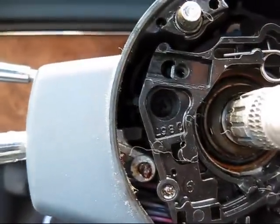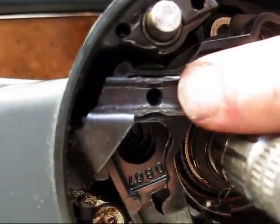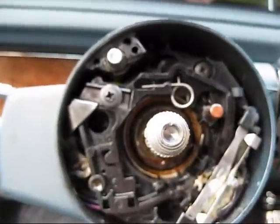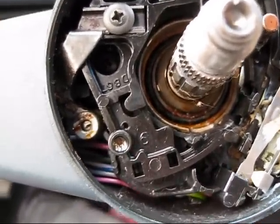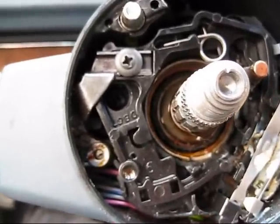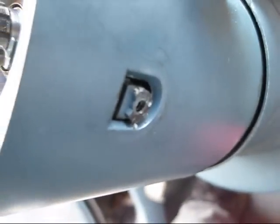And then we've got to reinstall the little actuator arm here. This is kind of hard to do one-handed, but I'll try. Just make sure that the hole's lined up there so you can get the screw in. Our actuator arm's in, our switch moves. Now, I really should get another spring for the left-hand turn signal, but unfortunately my local AutoZone doesn't have it in stock. So I'd rather just be able to drive the car and deal with the left-hand turn signal not working. Next thing we've got to do is reinstall the hazard switch.